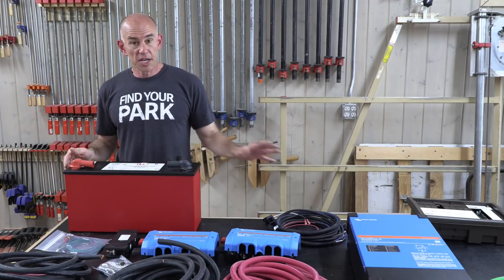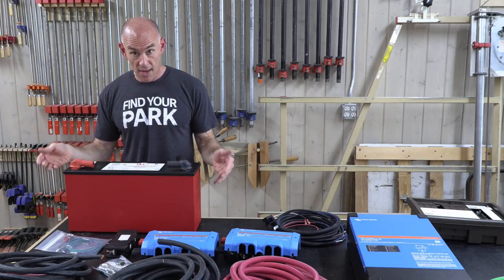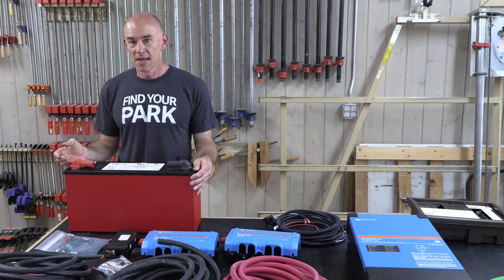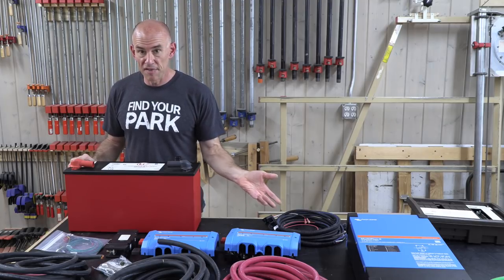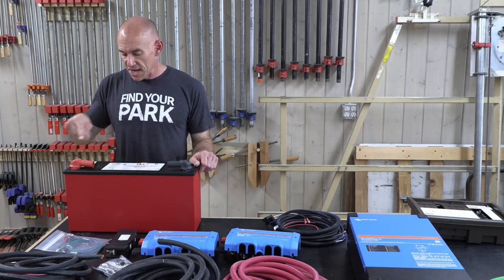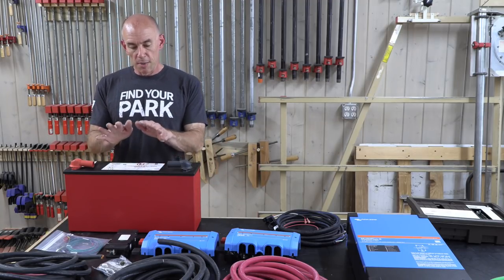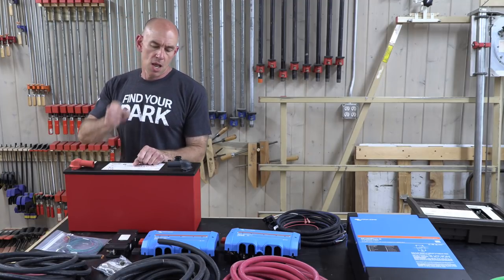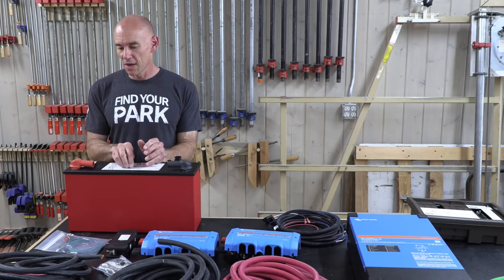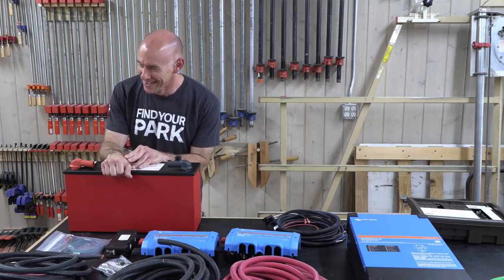The field control circuit lets the battery tell the alternator to stop - protecting against a load dump scenario where the alternator produces power with nowhere to go. Since any one battery can handle the alternator's full output, only one battery needs to be connected. So in my install: one battery connected to the field control circuit, one to the remote trip circuit breaker, and one to the temperature sensor - probably all the same battery since it's one harness, making that battery number one.